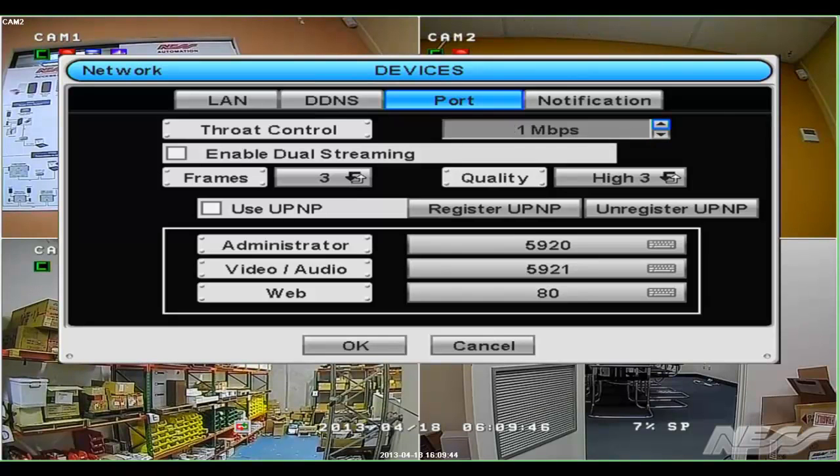I'll set it back up to unlimited. The other way is to set the frame size a lot smaller. Instead of sending out a 1080p image — even while controlling the throttle control — you can actually send out a SIF size image, which will make streaming a lot faster.